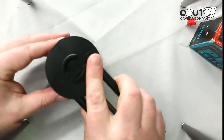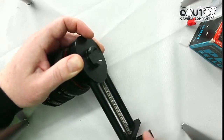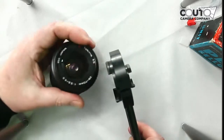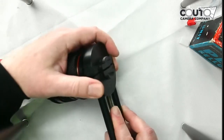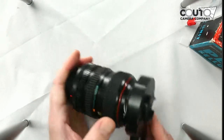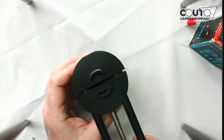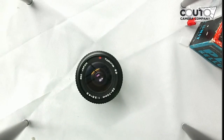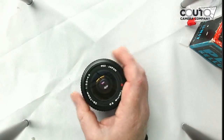There's not a great name for this tool because it's really only used in lens repair. I would call it a filter wrench or filter threader — though it doesn't actually thread anything. It will help you if your threads get dented. So if a lens were to get dropped on the ground and the filter threads get dented, you can use this tool to lock in and basically tighten it and stretch the threads back out. It does a pretty good job, but you have to have a lot of patience to use this tool. It's one of those things where you have to do quite a few small adjustments over and over again to try to get it to go on straight, and if you're lucky at the end you'll be able to get a filter back on.